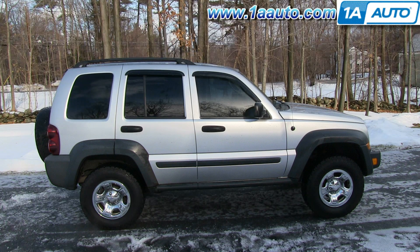In this video, we're going to show you how to replace an alternator on this 2006 Jeep Liberty with the 3.7 liter V6 engine. It's the same part and process on these Liberties from 2002 to 2007. The items you'll need are a new alternator from 1AAuto.com, 12mm, 13mm, and 15mm sockets, a ratchet, and a pry bar.